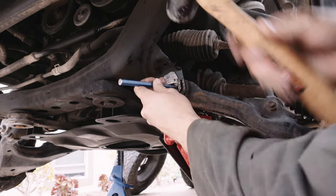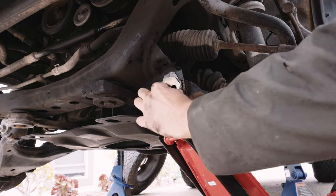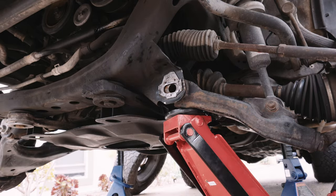Be careful not to damage the inside of the bushing if you need to use a punch and hammer. With the original alignment cam bolt out, I used my secret weapon from Bison Off-Road to help line up the outer tab as I mashed it back into place.